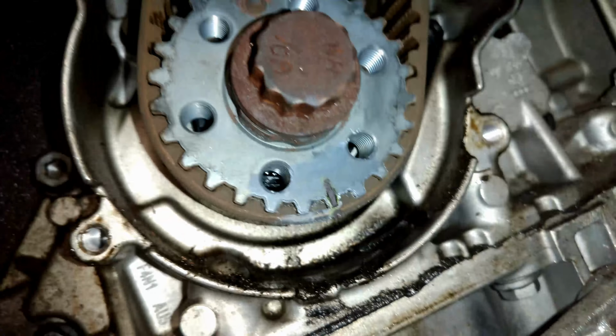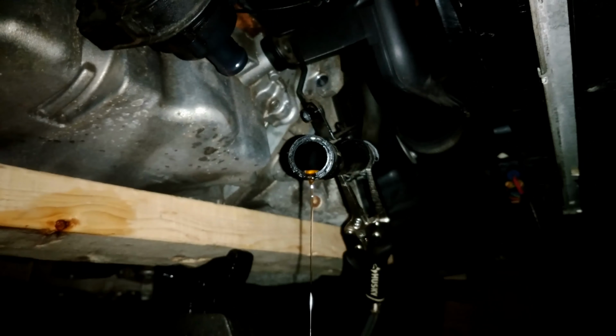As you can see, that's the engine oil pan right there. I don't know what this is. This looks like a solenoid of some kind, and you unbolt this bolt here that's mounted right there in the center of the screen, and that lets this pipe down. You can take a smaller hose clamp off of this and just pull it off of this plastic bit, and it's lower in the system than this is. And this came from a forum post. I'm linking that in the description as well for all of you who are looking to drain coolant on these. I would consider this to be way easier than doing it through this radiator hose, because you can tell with this radiator, see, there's no drain plug. I don't know why. I feel like I should have put one on there, but whatever. I took the timing belt off here.